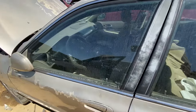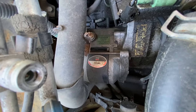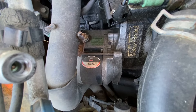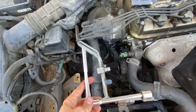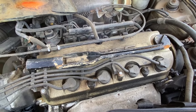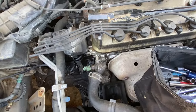The 95 Accord would have the starter I need. Taking a closer look, it's a re-manufactured starter, looks to be in pretty good shape, so I'm going to grab it — saves a lot of headache searching all these cars. Apparently 1990 through 2002 Accords are all compatible for mounting on the transmissions. Junkyard tip: I only brought a three-eighths ratchet and couldn't get leverage on the 17mm bolt. I found a folding lug wrench on the ground and slid the ratchet into it, giving me an extra 16 inches of leverage to break it free.